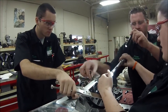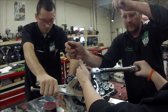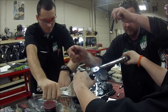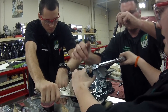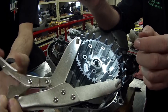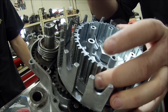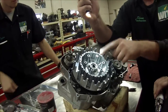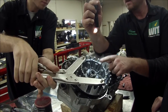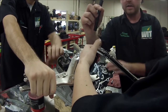Tyler here is using a special tool by Motion Pro to hold the basket. What's happening is we're literally forcing and wedging over those splines. How easy is that to overlook if you don't know? You put the nut on, you put your pack in, you just keep going, and then all of a sudden your clutch doesn't operate properly.